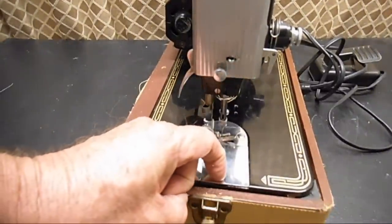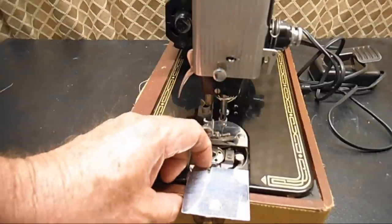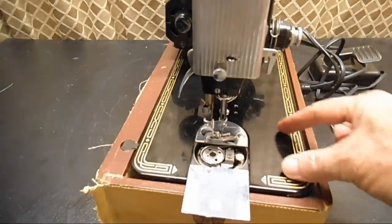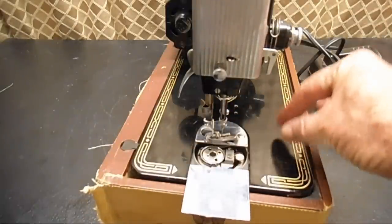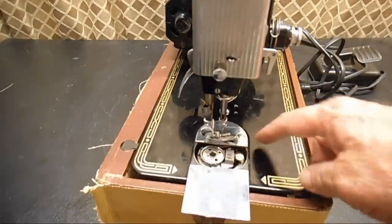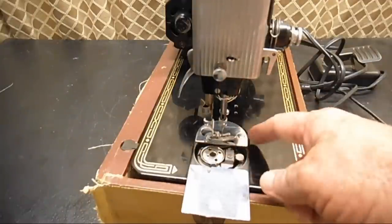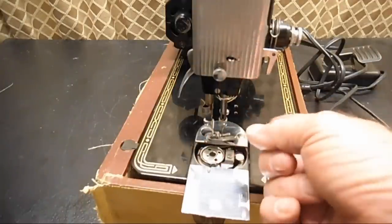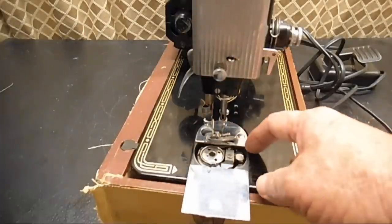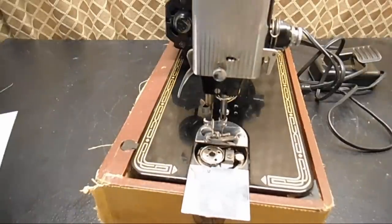This has a top drop-in bobbin, and it is a Class 66 bobbin. But where the 301 and the 400s and 500s had what was called a front drop-in bobbin on a horizontal rotary hook, this is a top drop-in bobbin, and it's a horizontal hook, but it's an oscillating hook. The hook goes back and forth on a bell crank mechanism, like the model 337 that I did, if you've seen that series on my channel.